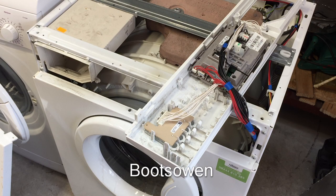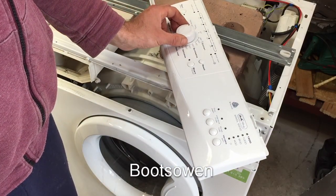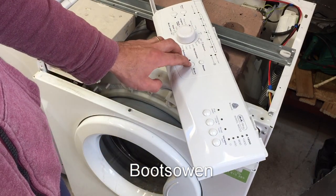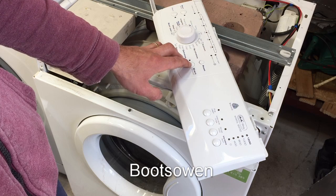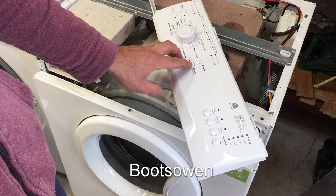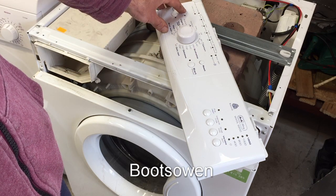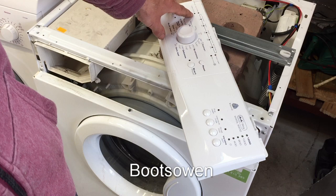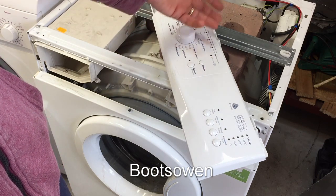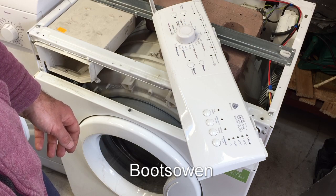Well, there's one thing we can do before I go further — let's just turn it on to spin again, gentle spin. Close the door, press start. We're getting nothing back — no service light, no door open light, nothing. It's actually quite a cool machine: it's got water tap closed, clean pump, some diagnostics with a visible readout for simple things to the user, which is quite useful. But I don't see anything happening.